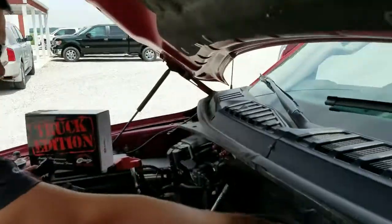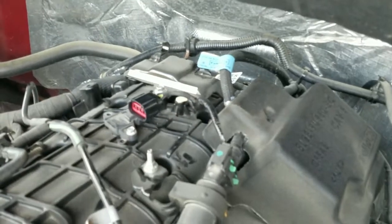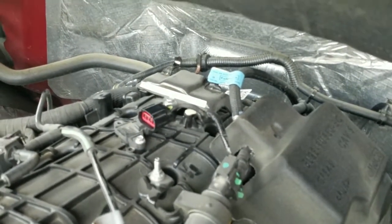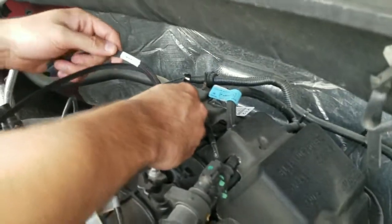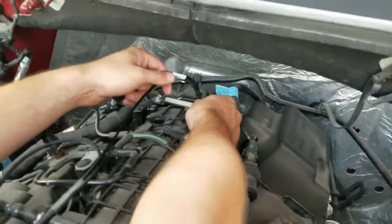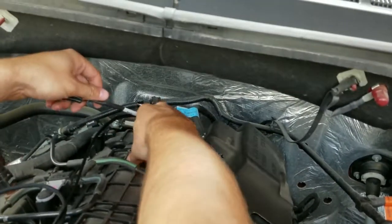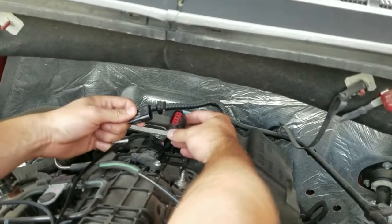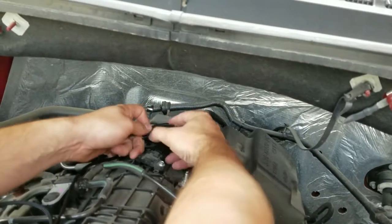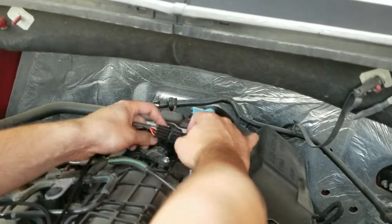We'll go through and take the map sensor off first. This is just a snap and release — you can see that's a four-pin female going into the male portion of the map sensor. We will now take our female portion of our harness; this will be labeled "map" — all connectors are labeled — and we will slide that on. These connectors are only going one way, so don't be alarmed about getting them on backwards because it's not possible. Then we'll take the male four-pin off our harness to go to the factory four-pin female and ensure that they all snap and lock and are safe and secure in place — we don't want those to come loose.